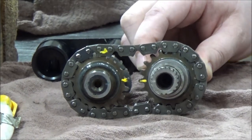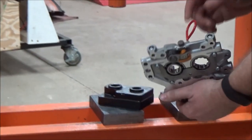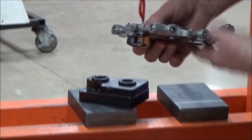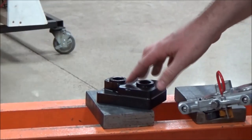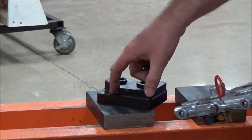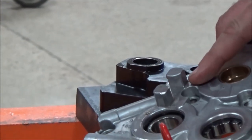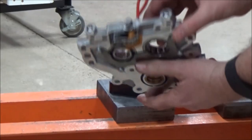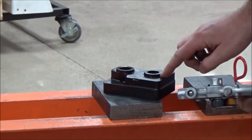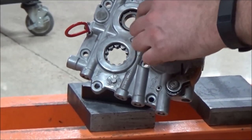Leah's going to help me here. Why don't we focus over here on the press? I want to show you the tool that we were using yesterday. This is a specialty twin cam tool by Jim's. Do you see this cutout right here? That's pretty important because what that's going to do is make a relief for this. These raised portions are going to fit inside the cam support plate nice and perfect.